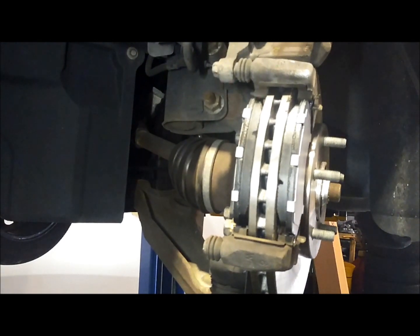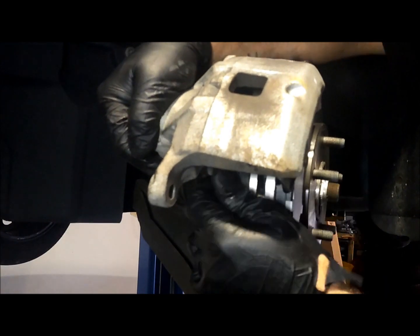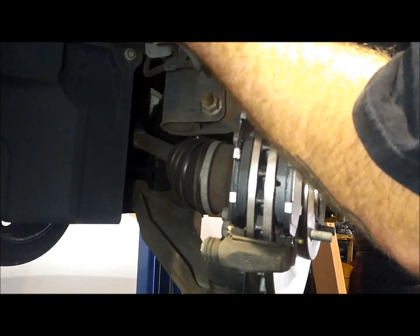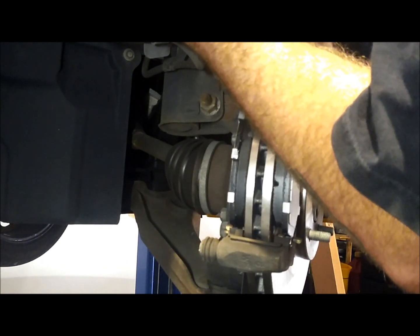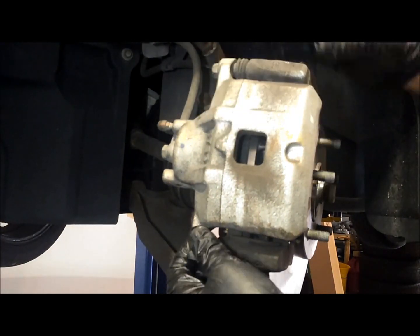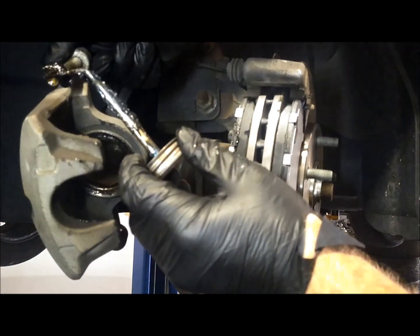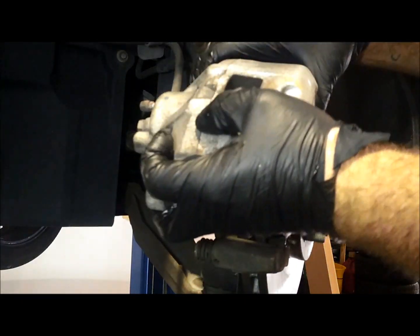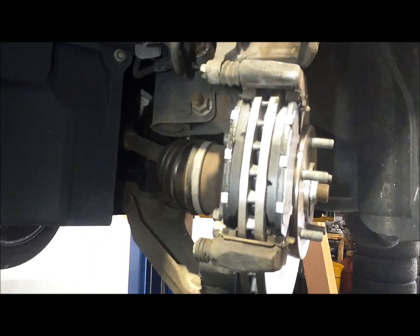It took me a while to do this, so my piston came out a little bit in the caliper — I compressed it a little prematurely. But it's actually good because I also forgot to grease that top slide pin. I hopefully would have realized anyway, but I catch it here. So I'm going to remove the caliper, slide the pin out — it's still bolted to the caliper — and I'm just going to grease it.